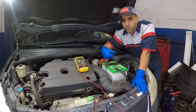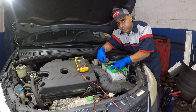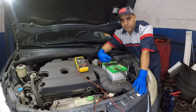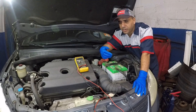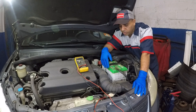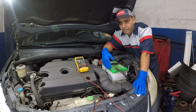What you'd be checking is how much voltage is coming from the alternator. You should have above 13 — 13.50, 13.75, 13.40, 13.55 — any number as long as it's above 13 volts. If it's below 13, if it's 12, pretty much you have a bad alternator.